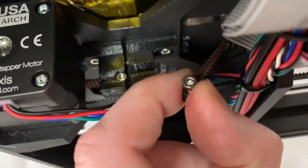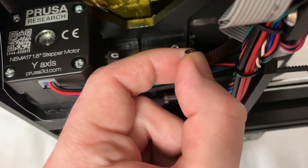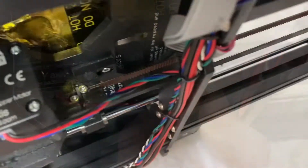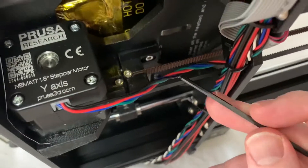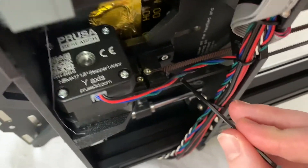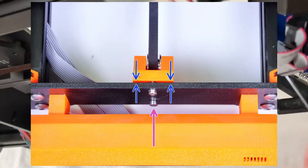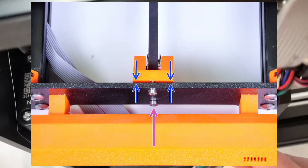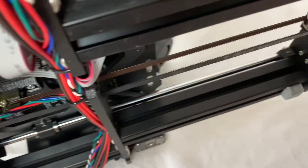I've got it wrapped around there and I just need to put that back in the socket, making sure that the belt is wrapped further around than it was last time. I've pushed it back in — it's a little bit tricky, you have to hold that and push it in, but it's not too hard. If you have a lot of trouble with it, the manual says you can remove this piece by undoing these screws. If you do it that way, make sure you mark the belt so you know exactly where it is, because the whole thing will be loose when you take that off.